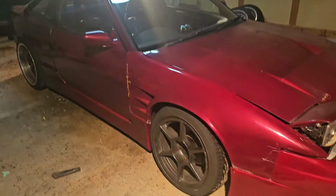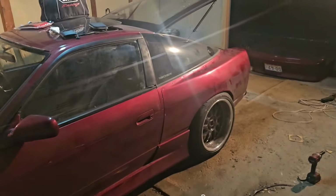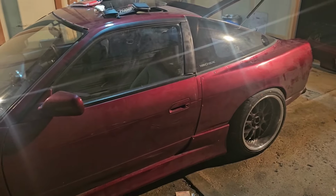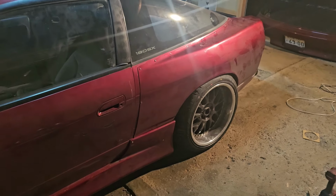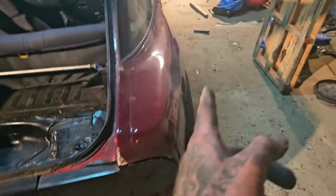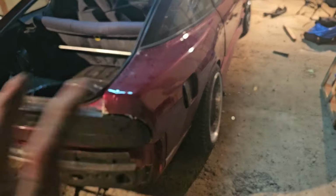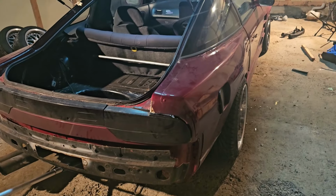Yes. Sick. Stockhead. I still like the rear to go down another 20 mil, I've decided. So I'll drive tomorrow like that. I've taken camber out of this side, and I've added camber onto this side, in. Now they sit basically identical. I should probably just go get a wheel alignment here, but I've got other priorities and that's drifting.